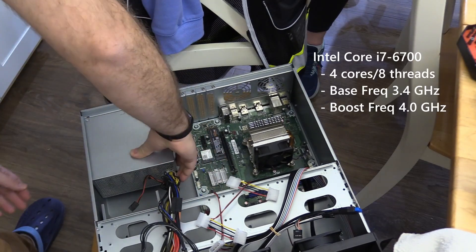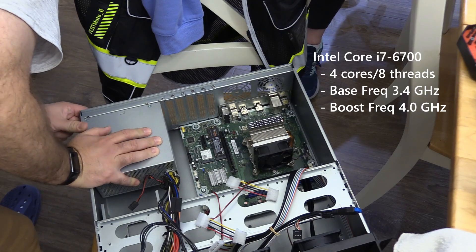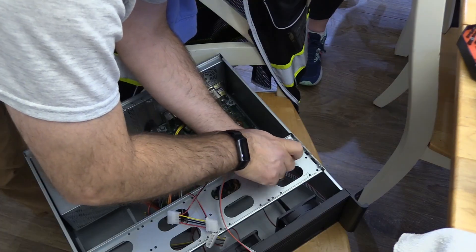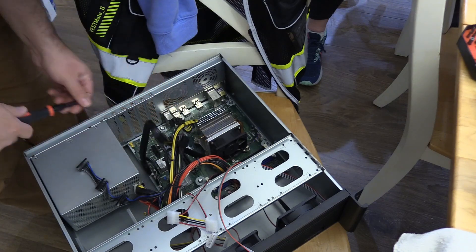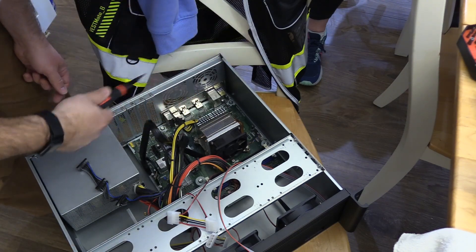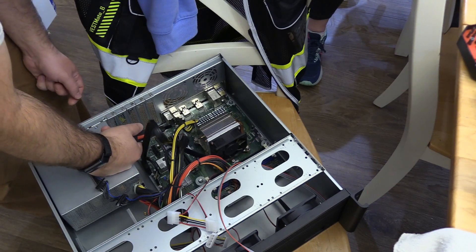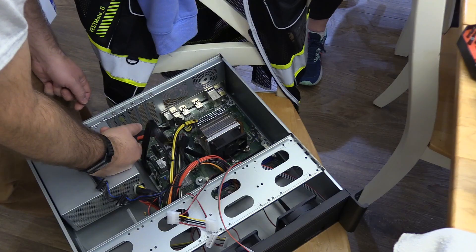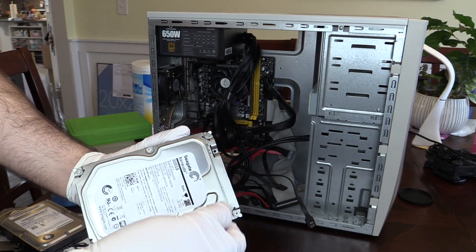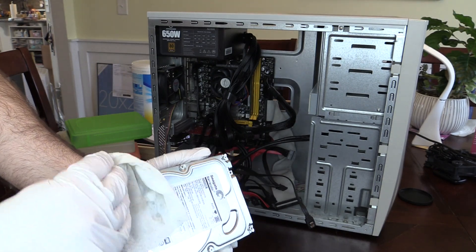It is running an Intel Core i7-6700 along with 48 gigabytes of RAM. If I have all the drives spun down, the power draw is around 23 watts, but I'm running into some issues with that, so idle power really is about 44 watts. My plan is to make this my new everything server, so I installed my two old 3TB drives from Socks, marking those through decommissioning.